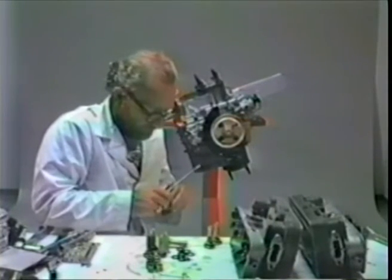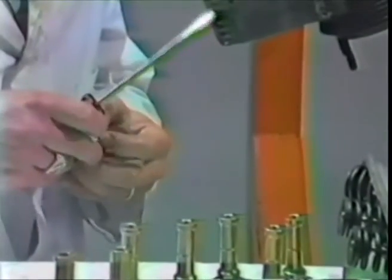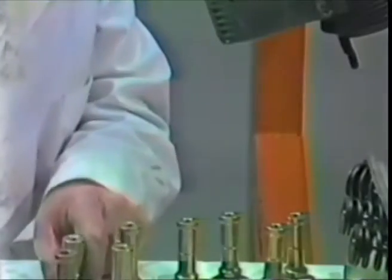The only problem is that these seals can be sometimes very hard and therefore very difficult to remove. When you first take them off the engine, you'll find they're not too terribly hard, and they can be removed fairly easily at that time. After they go through the stripping solution, through the plating solution, they usually become very hard and brittle and not very nice to play with.